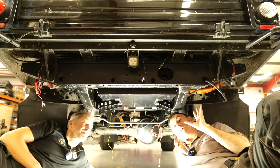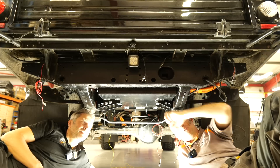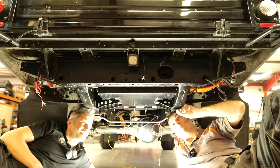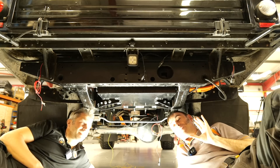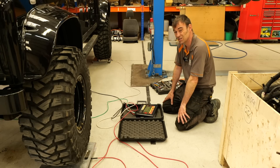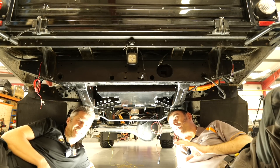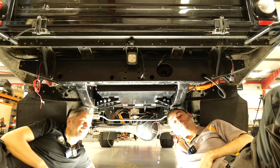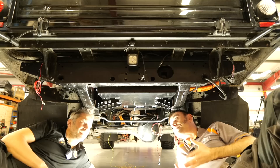Under the rear of the Defender 130, the rest of the battery pack is here where the original fuel tank was. Between this one, the mid pack, and the front pack it's 170 kilowatt hours total. The best thing was we corner-weighted it the other day — the truck came out 50/50 weight distribution. It's not going to handle like a sports car, it's still a monster of a vehicle, but 50/50 weight distribution is pretty impressive.